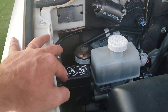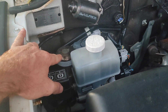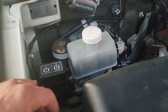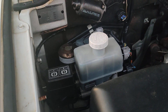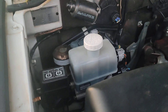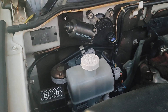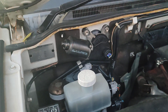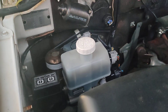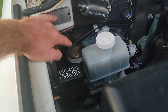The failure could be one of a few things. If these relays get stuck, the electric pump stays on and basically over-pressurizes the accumulator. There is a mechanical over-pressure release, and that's the noise you'll sometimes hear. It can happen even with just the ignition on without the engine running, and you'll get a beeping from the dash with warning lights. If you pump the brakes the noise will go away momentarily, then the pump keeps running and the noise comes back.